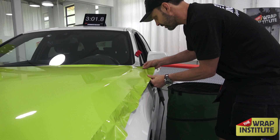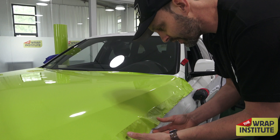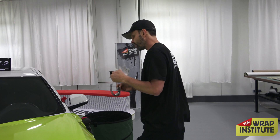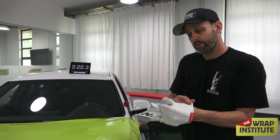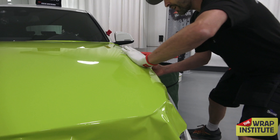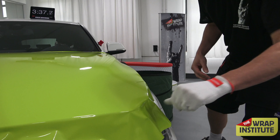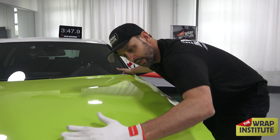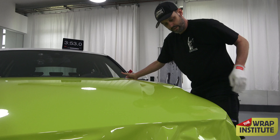I'm almost at the point where I've got it nice and clean — I run my finger on the edge and stage one is done. I've created 100% glass. Now I'm ready to squeegee. My watch comes off so I don't scratch the wrap, and I put on an application glove. I'm going to apply the recessed areas first using a technique I call the palm technique, which I invented in 2016. Applying recessed areas first avoids what's called adhesive lines. I get the material in there nice and tight, make sure the air can escape, and then squeegee the flat sections next.